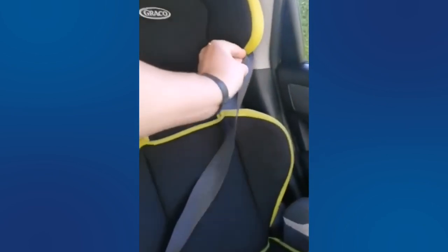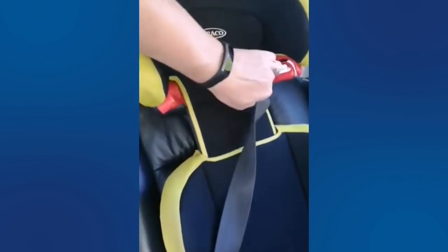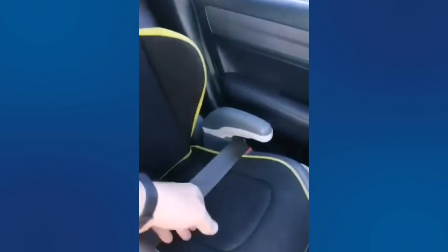Same on the backs — we've got a child seat here. So ideally, would you test it with the child seat in or without? The answer is with the child seat in, because that's when it's going to be used. You can see here it clips in. It should be fed through the correct slots on the seat — it wasn't. Make sure you've got clean hands when you're doing this as well. Check the position, check for any fraying. One thing I used to do was leave them clipped in.